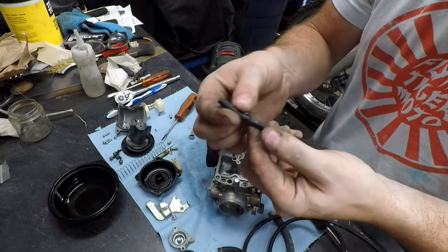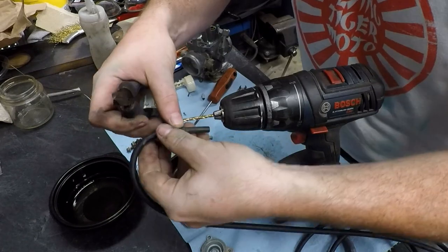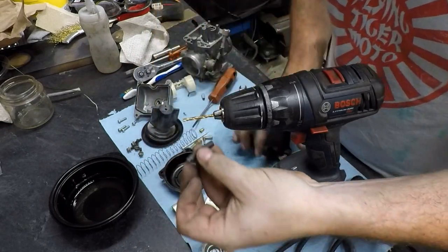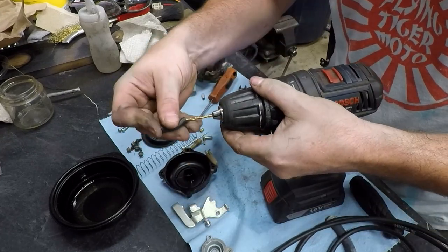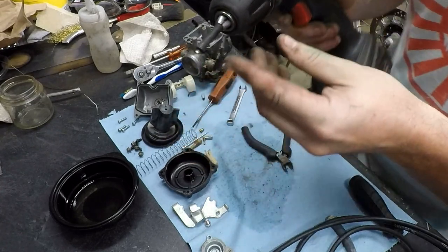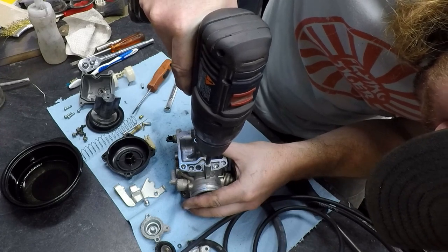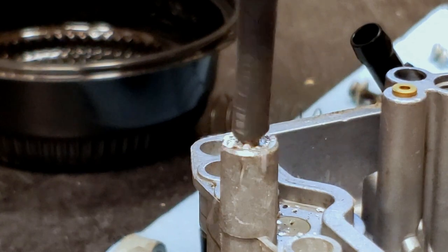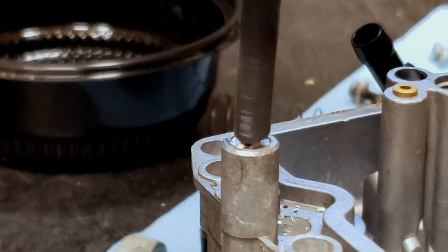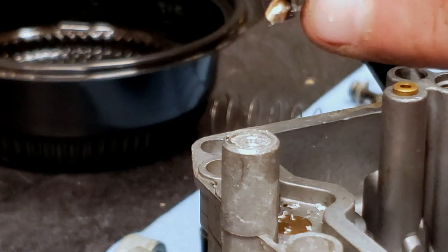We're going to use a little bit of vacuum line, whatever kind of hose that you have that's going to fit over your designated drill bit. So what we'll do here, we'll line this up here. We left just enough for the end. And that creates a drill guide. That way we can't go too far in. We're through there with no damage, and our drill guide stopped us.